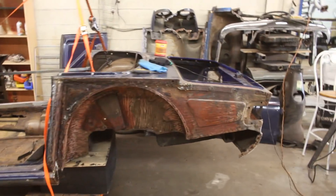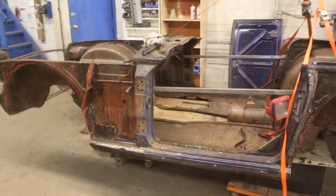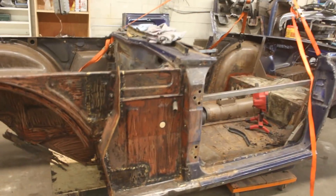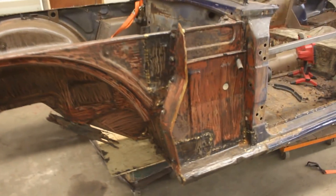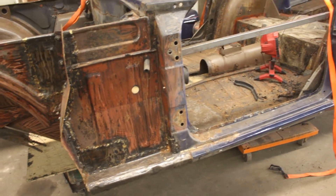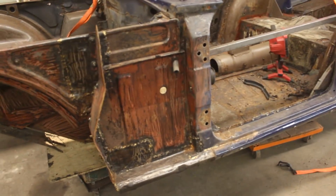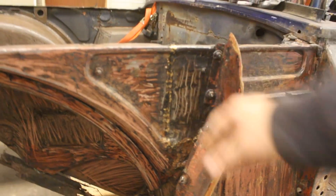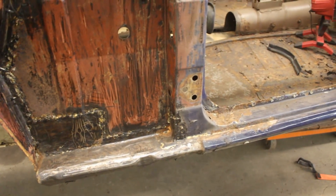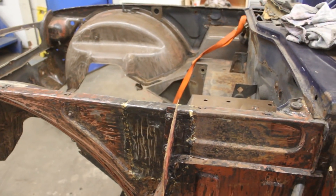Body time. My colleague Rao spent two days on this body cleaning up all the tar so we can see what it needs. There are some places that require a lot of attention, but there are some areas that I'm really pleased with — for example the boot, but I'll show you later. They patched some rust but just patched it right on top with pieces of metal, and this is where we'll have to peel this off and replace them properly because they left the rust inside.